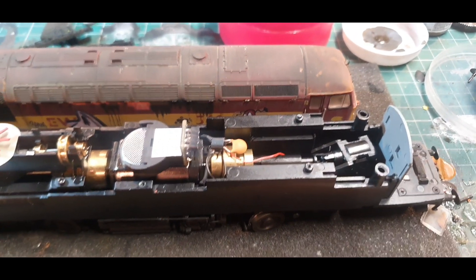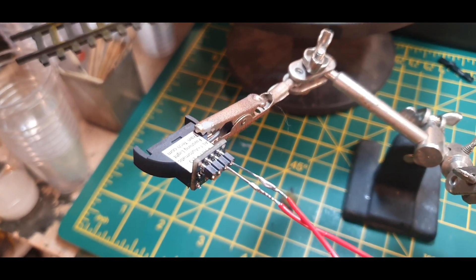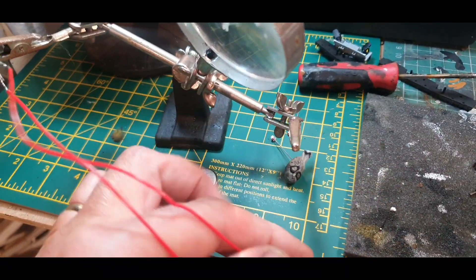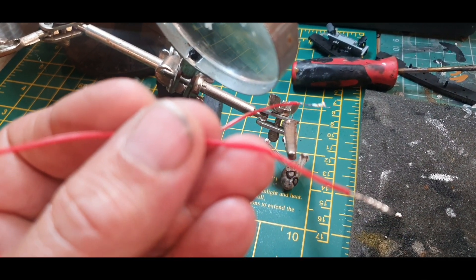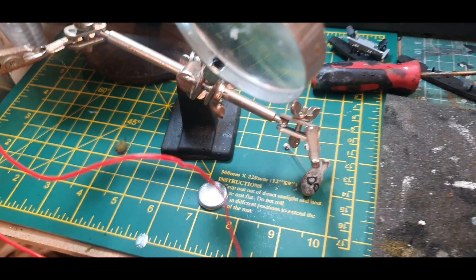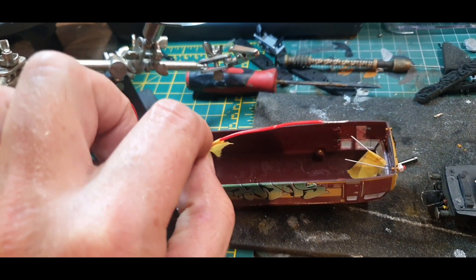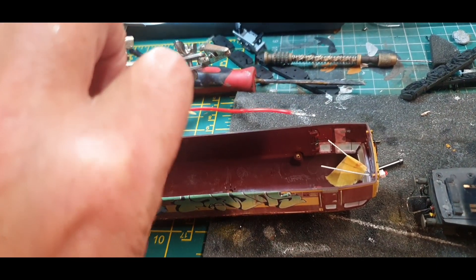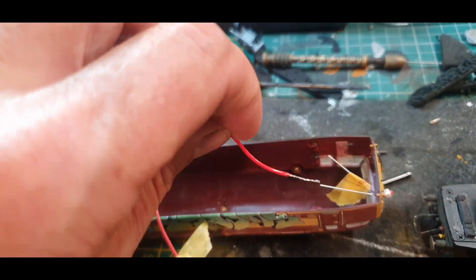I do like to do a bit of trial and error, so let's see how it goes. What I've done here is extended the two wires that go into the control unit, and added two extra wires so that they can go through to the front of the cab. I'm now going to solder these two onto the end of the LED. I've marked the wire to go to each corresponding wire using masking tape, and soldered that wire to that wire and that wire to this wire.